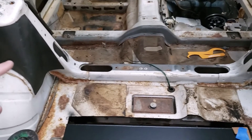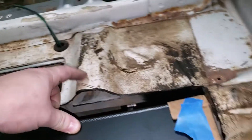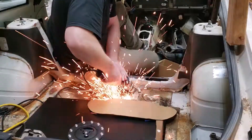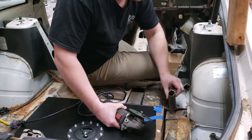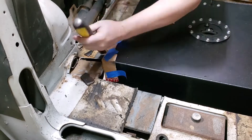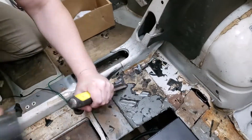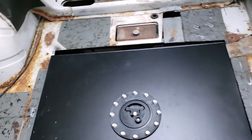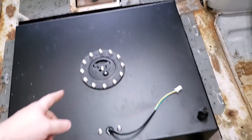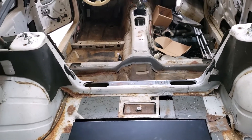Since we're going to mount the radiator in the rear, I think I'm actually going to mount it right behind this little brace, so we're going to get rid of these little tunnels — these were for the fuel line, so we'll go ahead and cut those out. Next time we're going to be removing the gas tank, welding up all these seams on the floor, cleaning all that up, and then we'll start making the brackets and mounts to mount the radiator. Stay tuned and we'll see y'all next time.